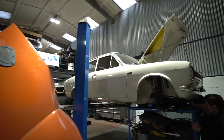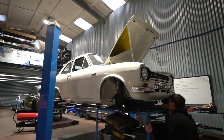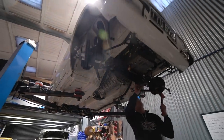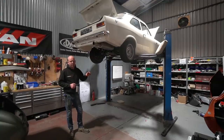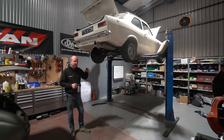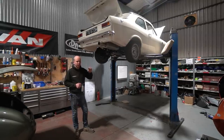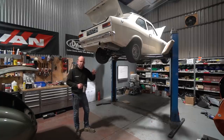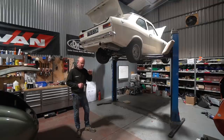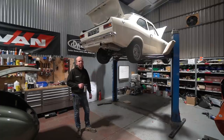The area we had issues with was the engine mount bushes — a World Cup cross member type bush as it would be referred to in escort circles. They transmit too much vibration into the shell. Having gone round and round in circles, we actually moulded our own polyurethane bushes at approximately 50 Shore hardness. They were pretty good but we had a concern that because they're not a bonded bush and the centre tube isn't bonded into the polymer, with engine movement it could eventually fret and break down the polymer.